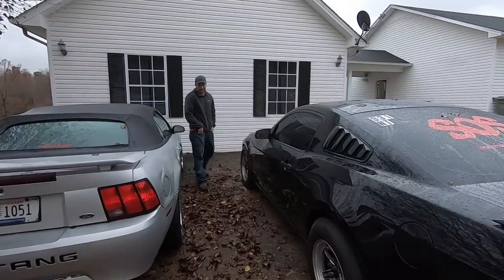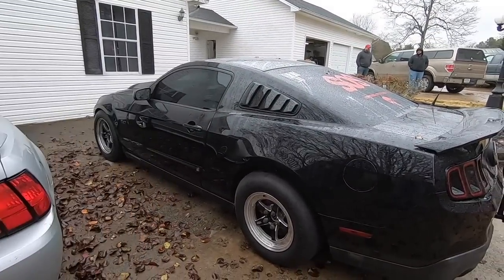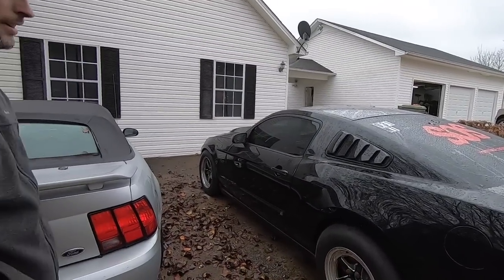So what wheels did you have on here? You had the Race SVE? Yeah, the SVE drag pack, 275/60 Pros, and they had the same tires you got up there on the front. But now the problem you were having is you went 5/8 studs in the back because you kept having issues out of this. I broke the half inch. Five sets of half inch by 20s this year.